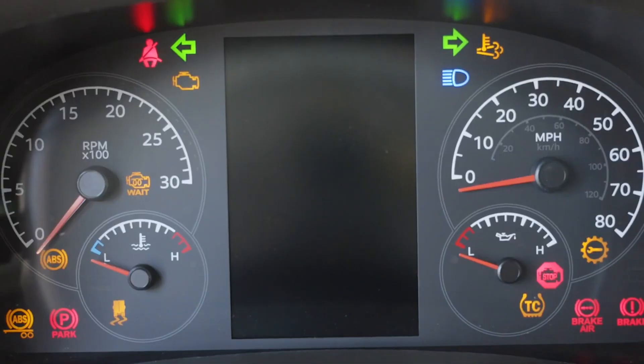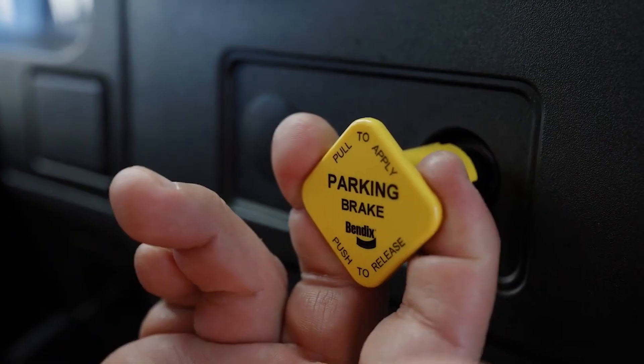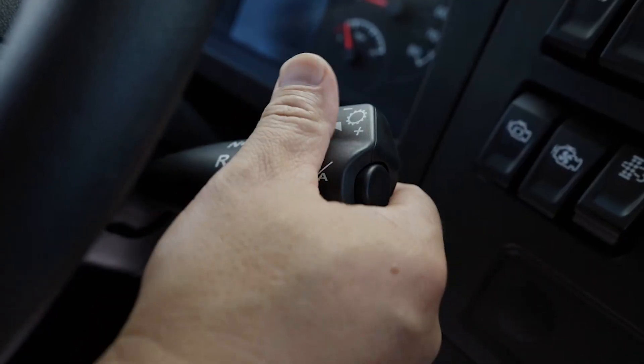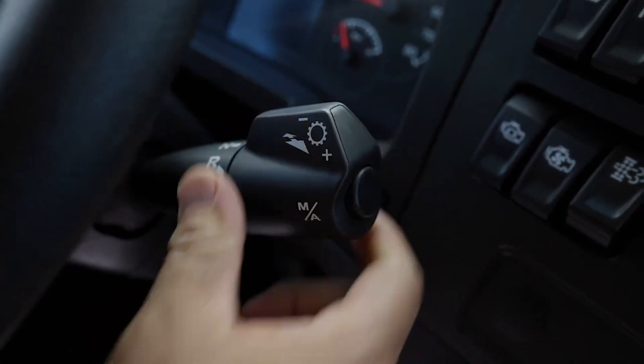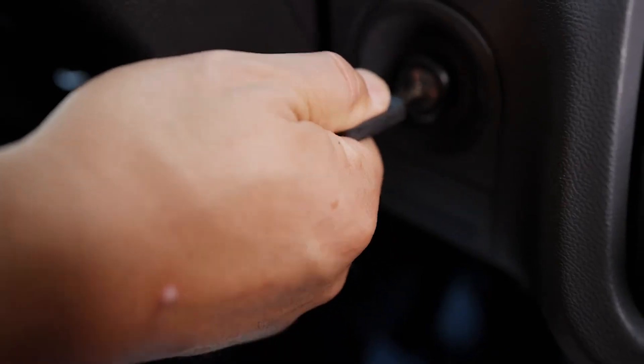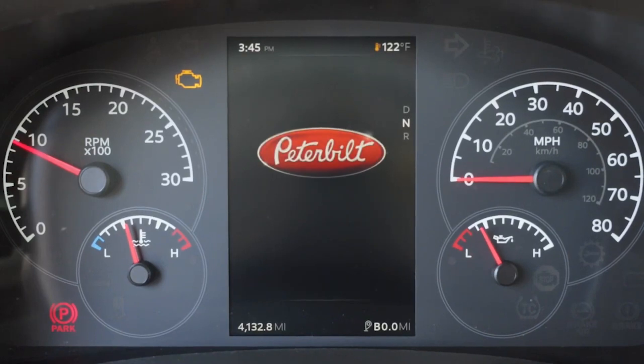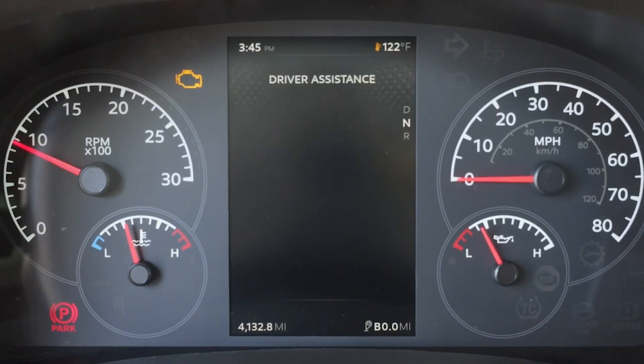Panel warning lights will light and the buzzer will sound until all main systems are ready. In this position, the ignition key cannot be removed. To start the engine, make sure the parking brake is set, the transmission is set to neutral, or disengage the clutch if fitted with a manual transmission. Turn the ignition key to the start position until the engine has started. If anti-theft is enabled, you will need to enter a passcode.